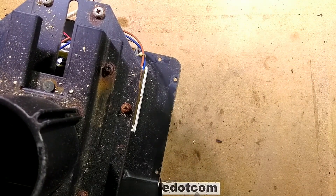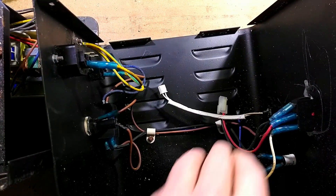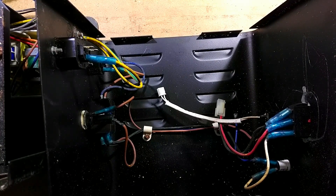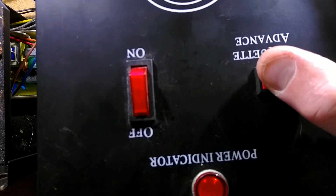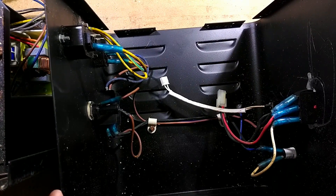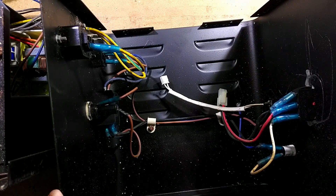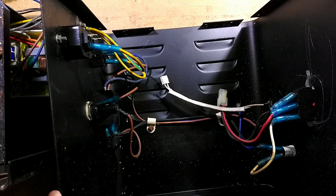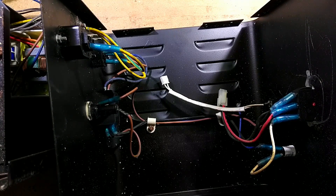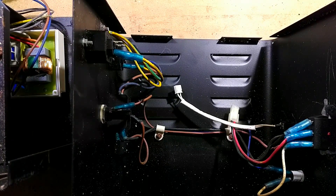The bit that was faulty was just the little switch down here. It was hot-melt glued in, but everything is just clipped in at the front. With these tiny little switches, it's a very close friction fit to the case, and it was squeezing just a tiny bit too tightly, causing it to bind. So I've taken it out, cleaned the switch, removed any slight ripples in the plastic of the switch itself, and because the hole it sat in was that tight — possibly due to the paint finish — I just removed a slight touch of paint around the edge that was squeezing it. Now it operates smoothly, so I'll put it back together and return it to my brother.